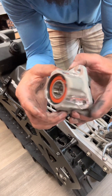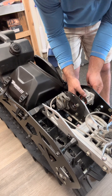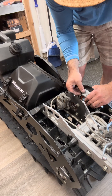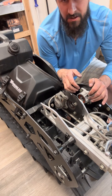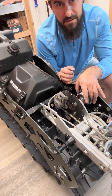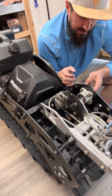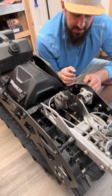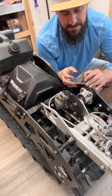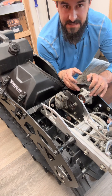We'll mount the new one. So right now I've got all four of these bolts mounted and not quite tightened. You actually want to leave just a little bit of slop in there so that when you do drive that jack shaft through there, that little bit of wiggle will help it go through straight. It's kind of floating in there, so I like to get it in there first, make sure everything looks straight, and then slowly tighten down these four nuts.